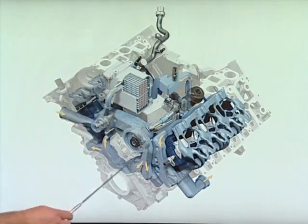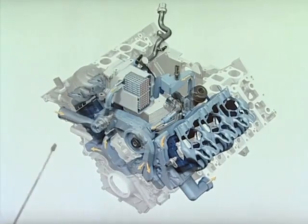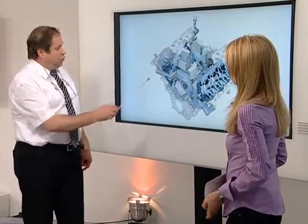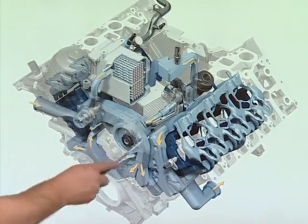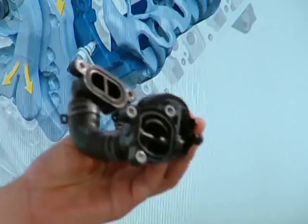The light blue areas are for cooling the cylinder head and the dark blue areas are for cooling the engine block. There are two separate areas. The first is via the characteristics thermostat, which can be opened even wider by being energized from the engine control unit, enlarging the cross section and controlling coolant supply from the cooler into the cylinder head area. The second area of block cooling works via a ball valve on the supply line in the engine block.